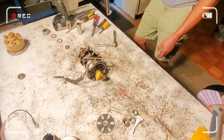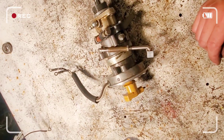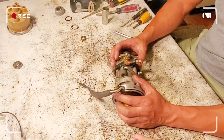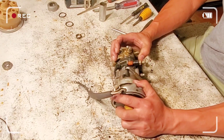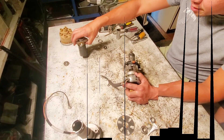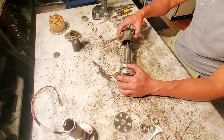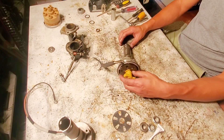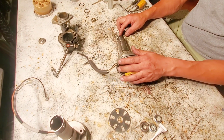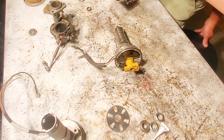So now we're going to start with the disassembly of the distributor. With everything loose, this should just pop off and slide off — wow, that's so oily. It needs to be oily. So we're going to pull that out and set that aside. And that's going to come off too. Now we got the rotor. Now we need to pop the rotor out — we're going to use a rubber mallet. Not the hammer — the rubber mallet, but this is still technically kind of hammer time.